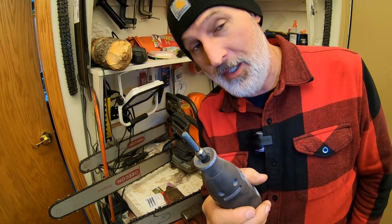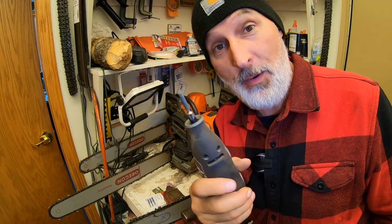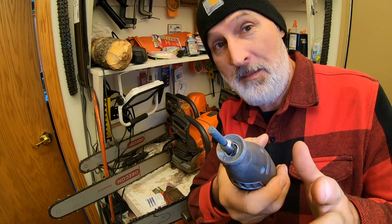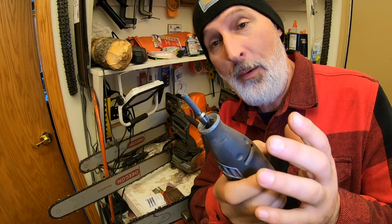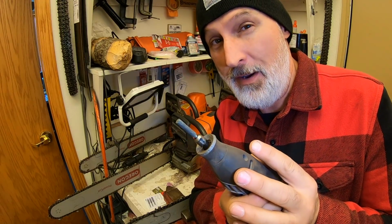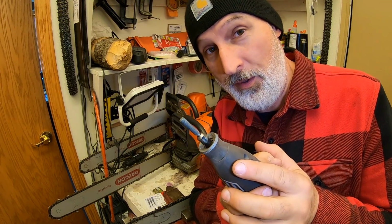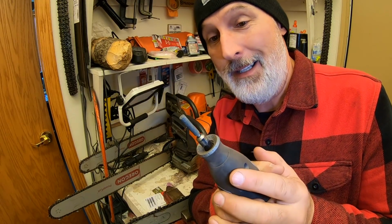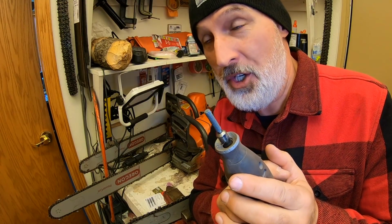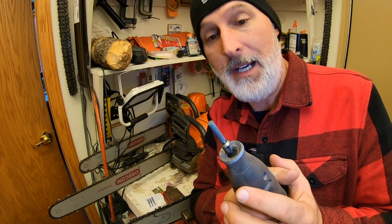And the next question is going to come up right away. I know you're thinking this. How many sharpenings do I get out of a bit? Usually at least 3 to maybe as many as 6. It just depends on how dull your teeth are. If you've hit the ground, hit a rock or something. Because if you hit a rock and you actually take chips and chunks out of the front of your tooth, the top of the tooth, it's going to take a little bit more grinding, and then this wears down faster. But if it's a new chain, or a chain where you're cutting really good clean wood where there's no dirt, no rocks, you're not hitting the ground at all, you can get 5 or 6 sharpenings out of one.